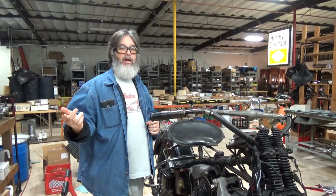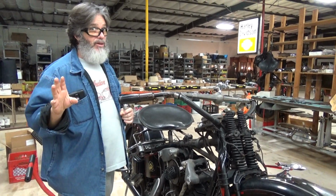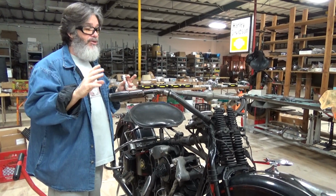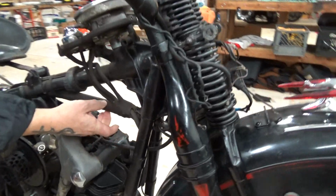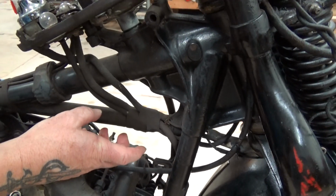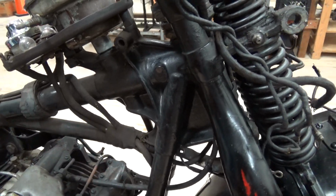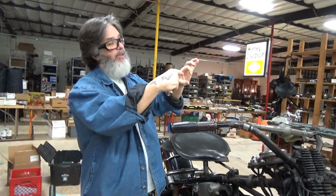Then they remake the neck. They remake the neck, and I don't know if they changed the check or not. I don't have the bikes here to confirm or deny. I don't know. But they changed the neck, and what they did, it had a bigger space here where the thicker bar, right here, was machined out, but because they still had some of these bars they were using, some of them they used the thinner bar and they machined a little spacer and stuck the thinner bar in. So you've got like a wide opening with a spacer and a thin bar in it.